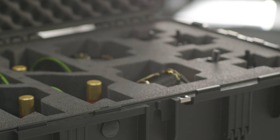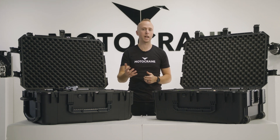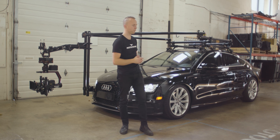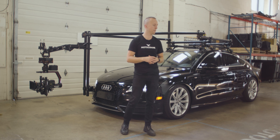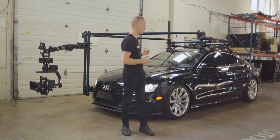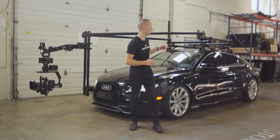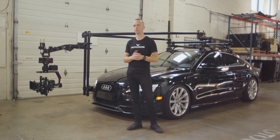Now that we've seen all the components, let's see how our Audi A7 — which has no rigging modifications whatsoever — is using the Ultimate Bundle practically. We're using it to transform this Audi A7 into a camera car without any modifications to the car at all. We're using the SSG kit with four nine-inch cups on the roof and four 90-degree speed rail clamps to create a strong suction grid sucked down to the roof skin, with two ratchets providing positive interference through the cabin front and rear so you're never relying on suction alone. In this application shooting off the front, the SSG provides a strong anchor point for speed rail running forward to the front tow hook — or you could equally run those two rails rearward to a hitch receiver for a rear-mounted setup.